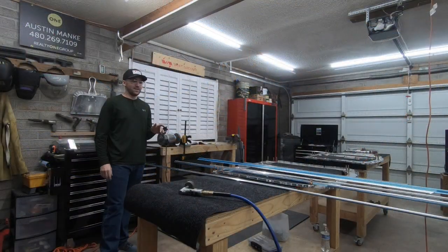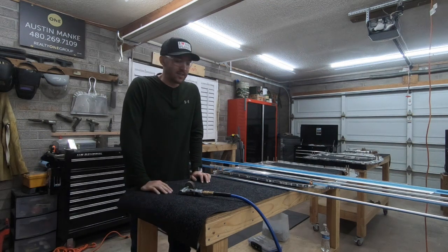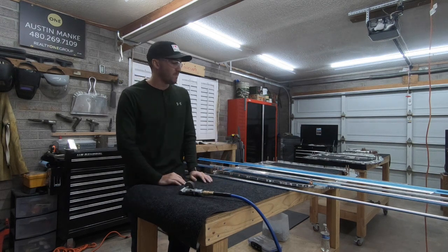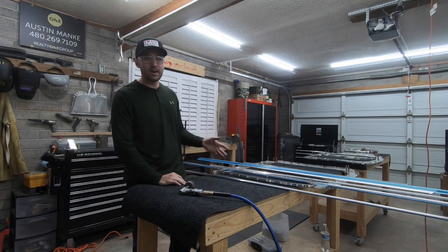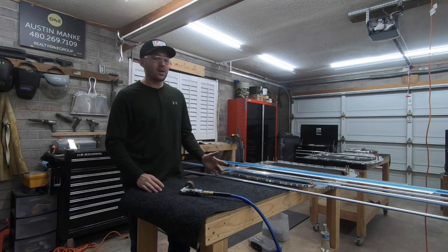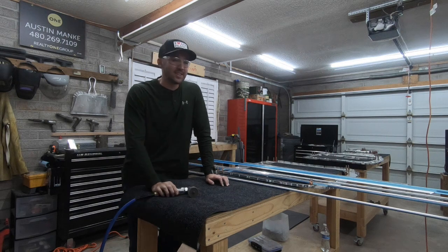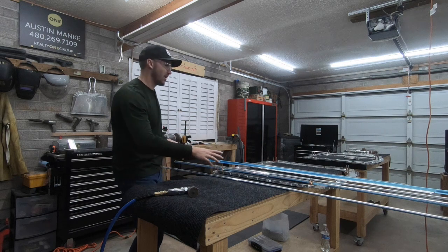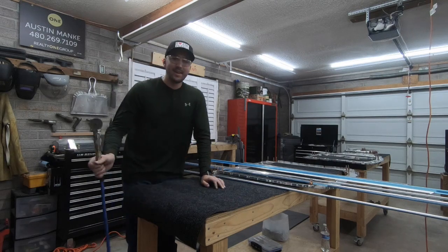The angle grinder definitely worked to do those 45-degree angles. The next step involves deburring them before we start making the whole assembly. You'll notice the blue protective film was left on one side — Vans calls for leaving it on one side, saying it makes it easier to get in and out of there. As far as deburring goes, these long sections would normally be a real pain — either trying to do it on the Scotchbrite wheel or running side to side.